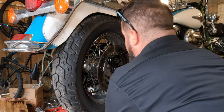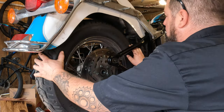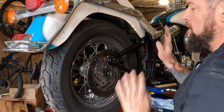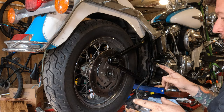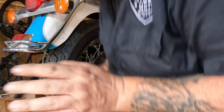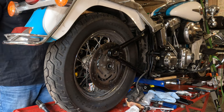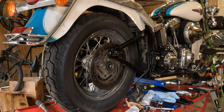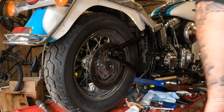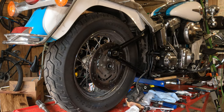Holy crap, there was a bracket underneath the tire. Move that stuff out of the way. Once the rear wheel is up in here, put the belt on first. I know it sounds silly, but trust me. Roll the belt on up over the pulley. It doesn't matter that it's not tensioned or anything yet. It's just a really good plan. Otherwise, you spend a lot of time down the road fighting with it. The belt's not too flexible, so.